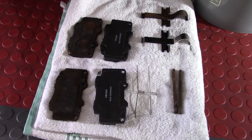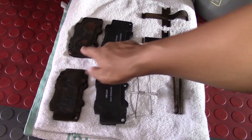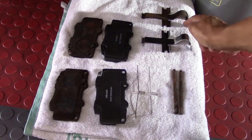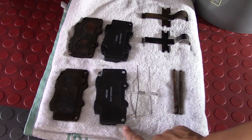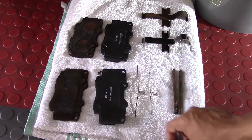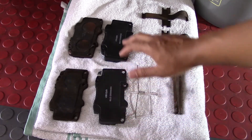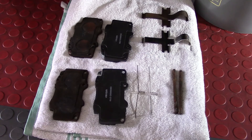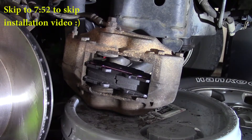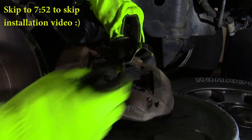As usual, I compare the newly bought brake pads with the old ones that were removed — making sure all the mounting locations and holes are the same, and comparing all the spring clip retainers. Note that I am reusing the anti-rattle pins as seen on the bottom right; new pads don't include new ones in the hardware. Everything else is replaced — brake pads and all retaining clips. New hardware for your pads comes with anti-squeal backing, but you can double up and apply anti-squeal gel or spray as well to reduce squeaks. I then show the process of reinstalling the new brake pads and re-inserting the anti-rattle pins and retaining clips back in their respective places.